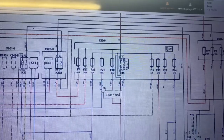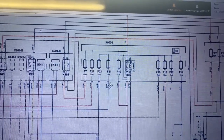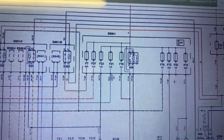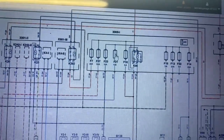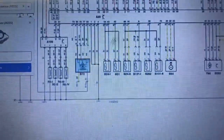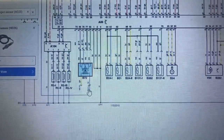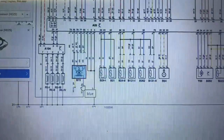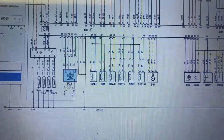At the car, we should be able to see 12 volts — or at least battery voltage, whether that's 13-14V running or 12.6V key-on engine-off. I'm not going to go to the fuse first; I'm going to go down to my lambda sensor and back-probe the blue wire there. I'm hoping to get 12 volts on my multimeter — that's what I'm looking for right now.